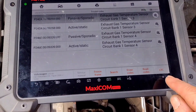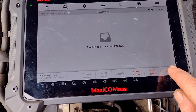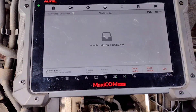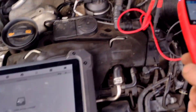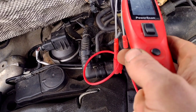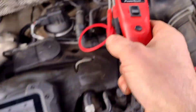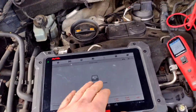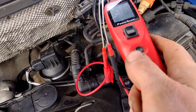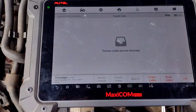I've unplugged others so we're going to see more codes - let's see if we can erase it now. It says it's gone. It did before though, so now we have to read it again to make sure. It's gone. When I read it again, it's still gone. So we can see what voltage it's happy with - that was 0.5 volts. My hands are shaking, but yes, 0.5 of a volt. It's happy at 0.5V. We know it's going to fix it because we've tested it - we haven't guessed.